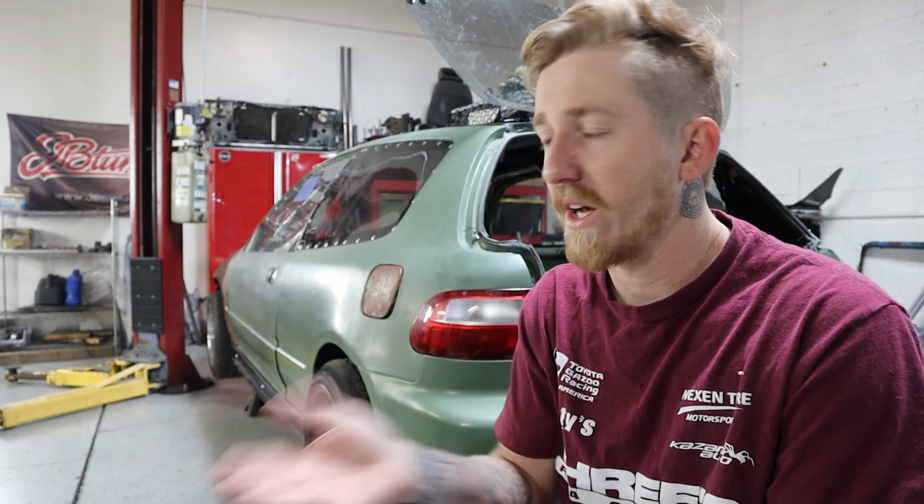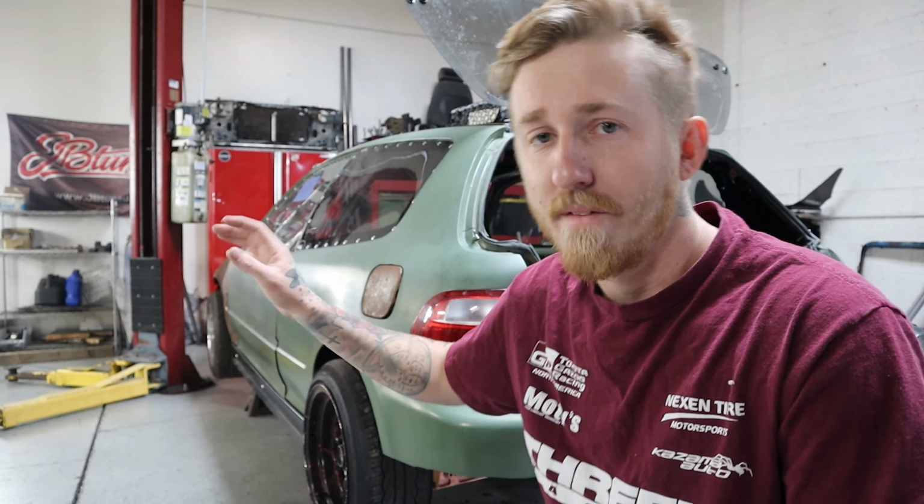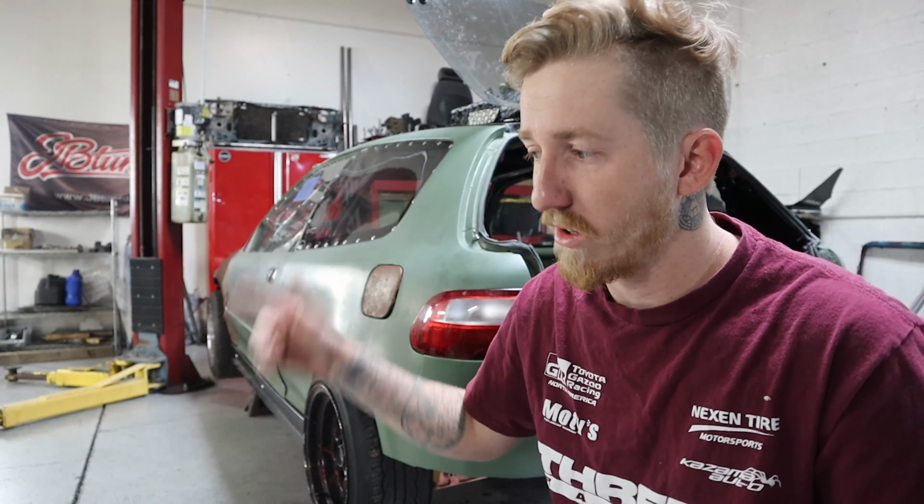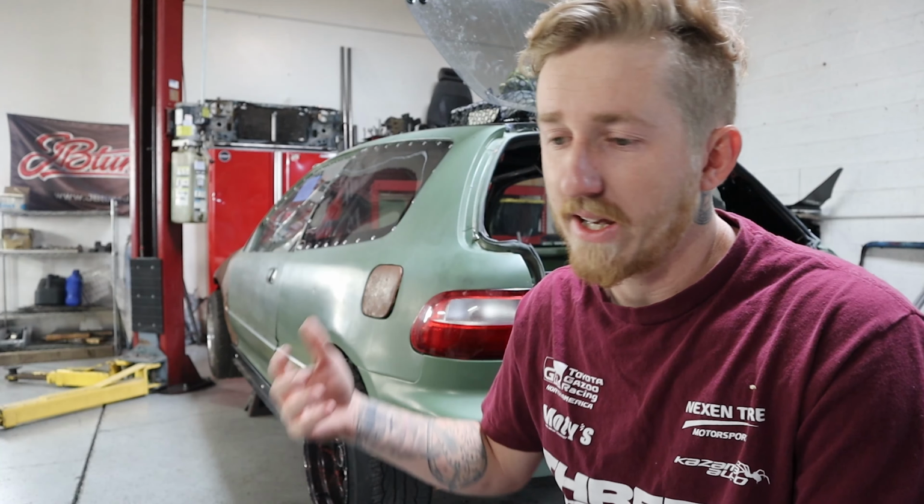The dash bar is far too long, double notched. Why notch it? Just send the bar, don't notch it, don't waste the time. And maybe that's a small grievance. I'm just noting, again, these are things that I've observed with this kit. Same thing with the harness bar. The dash bar and the harness bar are interchangeable lengths, one's like a half inch longer, so you can kind of pick and choose which one's which. But you'd imagine being the harness bar is already pre-notched that it would fit the main hoop.